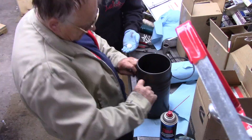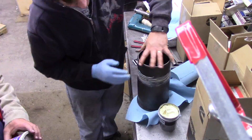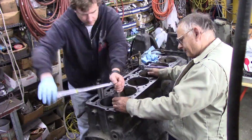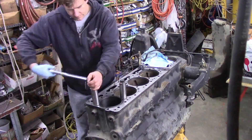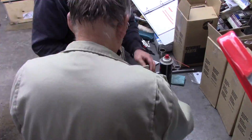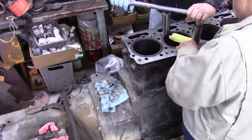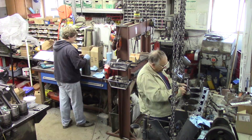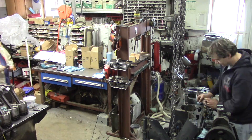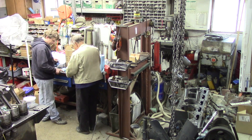Once we were ready, it was time to prep the liners: cleaning all of the cosmoline off — all the protective grease — putting the gaskets on, then lubing them up. We're using Lubriplate Moly, which was recommended to us by big truck engine builders. Now it's time to set the liners; they just dropped down in. We also put a whisper of black silicone around the top edge. The book didn't say to do it, but it's what we found in the motor when we took it apart and it hadn't leaked up there, so it seemed like good sense to continue.